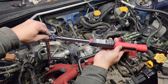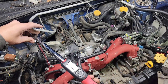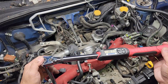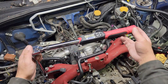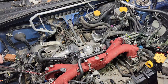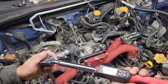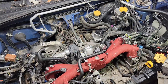The number is at zero right now, and then when you start moving it — there we go, it reads 18.1. Try on the other bolt — there we go. The middle bolt was already done, so it's all set to 18 foot-pounds. Going to double-check and run everything down. Alright, that side is torqued to spec — now let's do the other side.